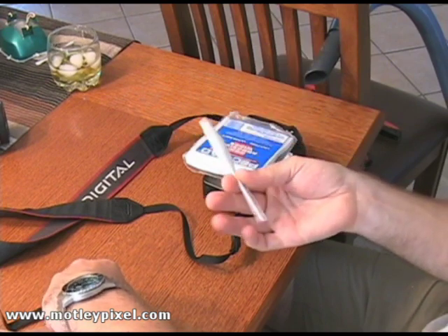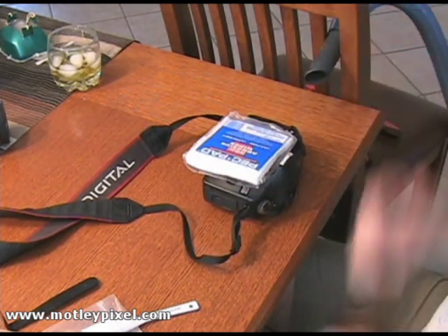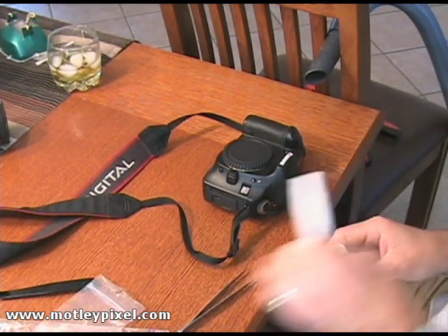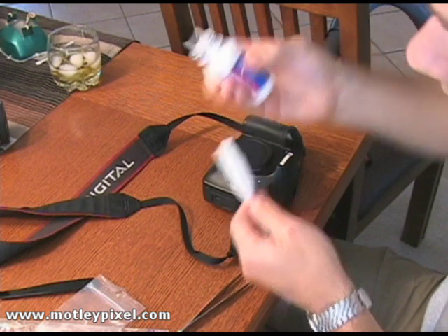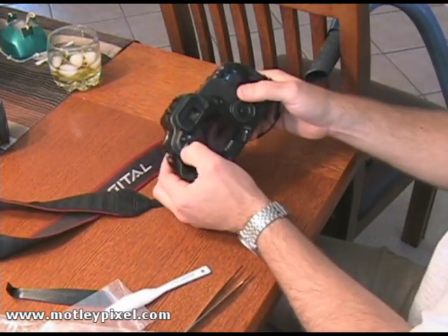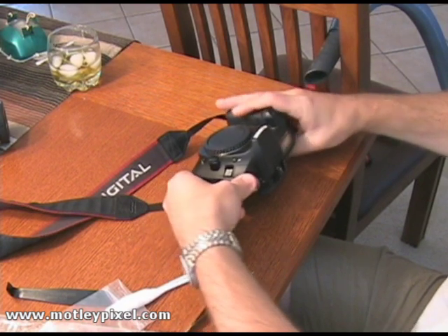That's why this wand is 14mm. I highly recommend buying the sensor swipe from Copper Hill Images because it's a soft tip — it's actually like a little spatula. For step one, I'm going to put about three drops of Eclipse on the old pec pad. Then insert it back into the plastic pouch, go to the camera menu: on, menu, sensor cleaning, okay. That's when the mirror pops up and the shutter opens — we're ready to clean. Take it out of the plastic pouch and turn the vacuum on first.